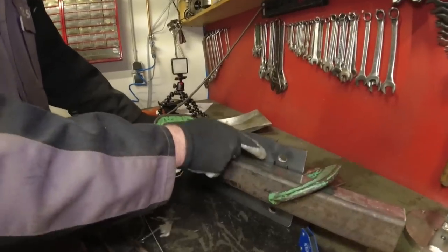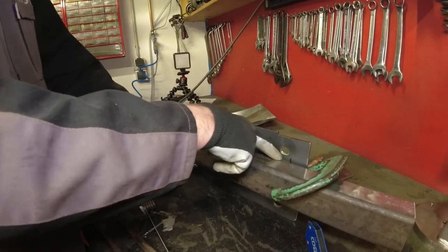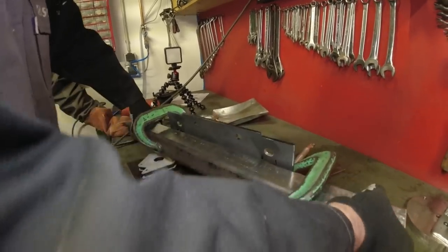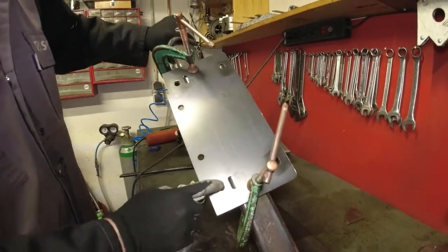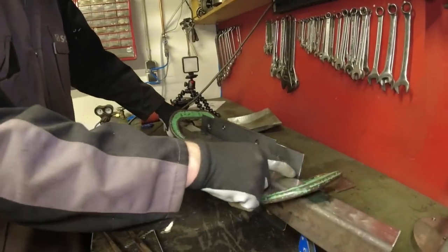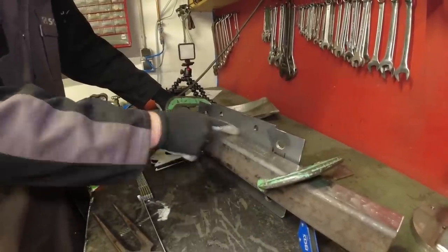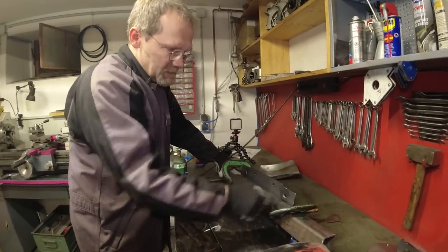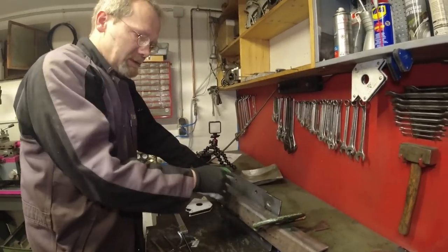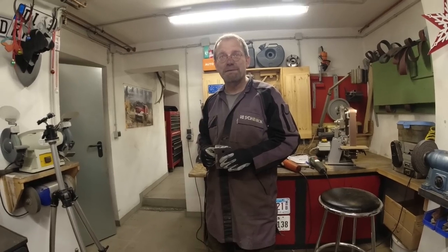So here, when you weld the winch bracket to the cross member, you gotta spare out these holes. I lasered in holes here, especially so you know not to weld across. The reason they are there is that you don't put a big bead across here and get interference with that bolt head. That's how smart that design is. Tack this here, here, here, and here, and then give it some real bead. A beefy bead.